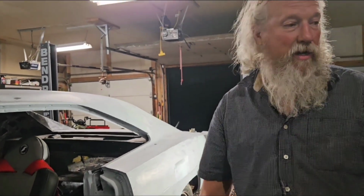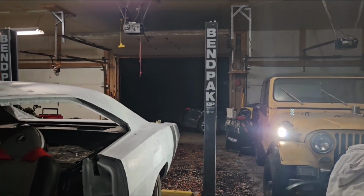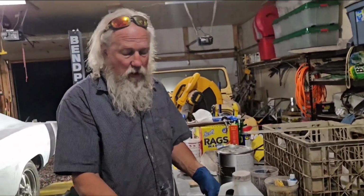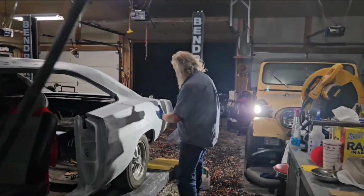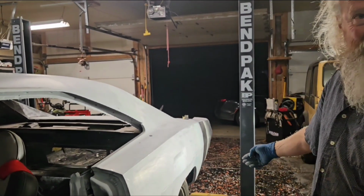If you want, I'll bring my red guide coat. And when I do put more coats of primer on it, it should make it even a little nicer, right? Oh yeah, it gives it a little more leniency. And another thing too, when you're spraying the primer, spray like this section right down here. Spray it, and then look, it's glossy.